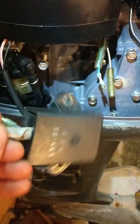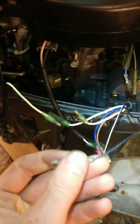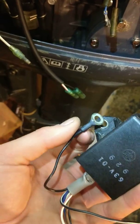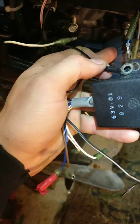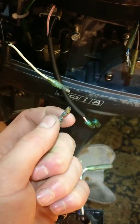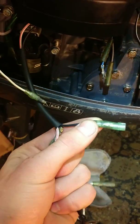Out of the unit comes this black ground wire. When you attach it to the side of the outboard, the ring washer will be placed onto one of the bolts which is connected to the main block — that is your ground on this engine. At the other end, this black plug will connect to the ground lead on the pulsar coil.